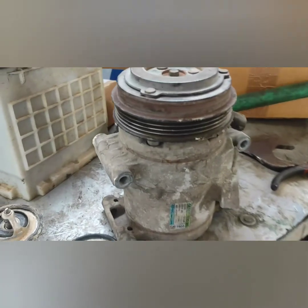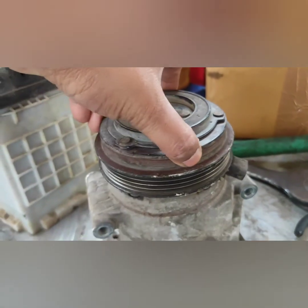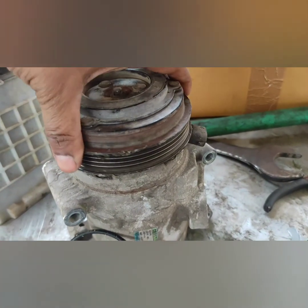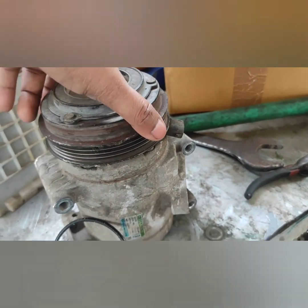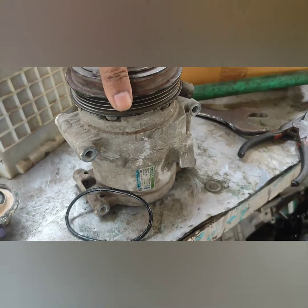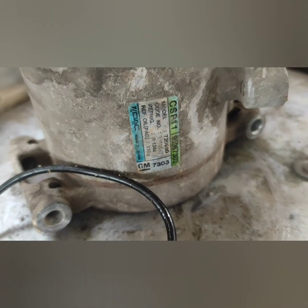As I have seen before, I inspected the compressor — it has a shock and a jam, it is not free. If the compressor is free, then it is not on. So here we change the compressor. When you change the unit, don't worry — we can save it with the pipe.